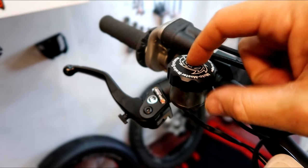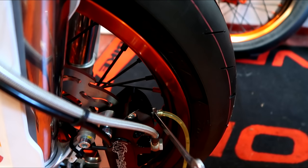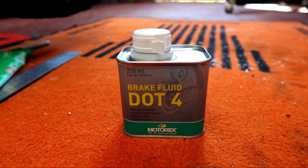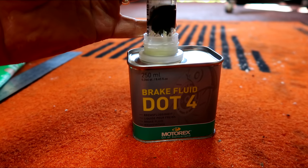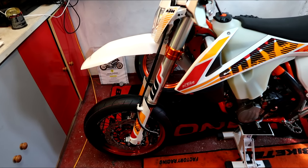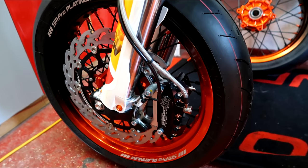Okay, bleeding time. Time to bleed — or rather fill the brakes. I've got my little bleeding syringe. This is how I do my brake bleeding, seems to work quite well, but it's going to be more tricky with a completely dry system. So we need DOT 4 brake fluid, a syringe to actually get it out because it's a ridiculous shape. I've just spent about an hour trying to bleed the front brake — it's just had a lot of air in it. About that much movement now.